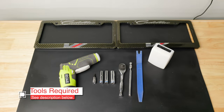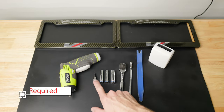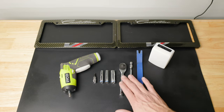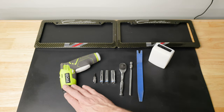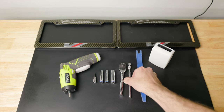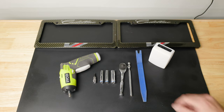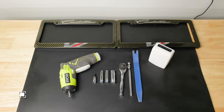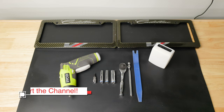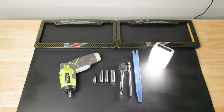Alright, for this installation you'll need the following tools: a T20 Torx bit, a 7mm socket, an 8mm socket, and a 10mm socket. You'll want something to drive it with — a ratchet, or I really love having my Ryobi here; it's cheap and gets the job done especially when my DeWalt is a bit big for the space. I found it handy to have a magnetic retrieval tool for screws that fall into hard-to-reach spots, and you'll definitely want a trim removal tool. Lastly, there's some dark area under the headliner, so you'll want some sort of light to illuminate the space.